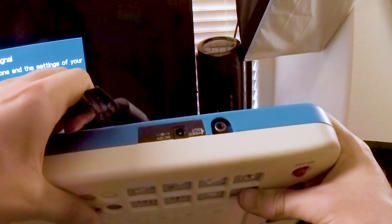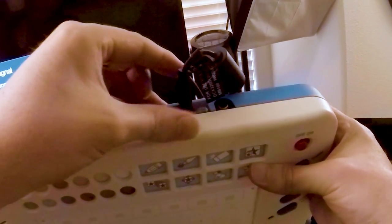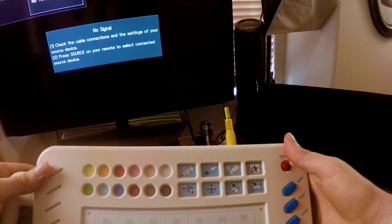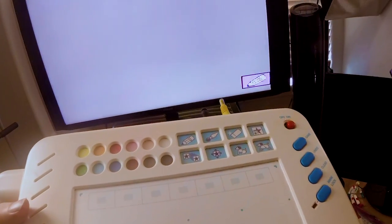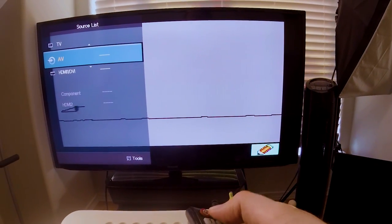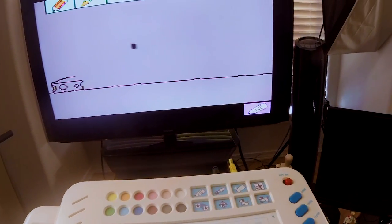So now let's move on to what you've all been waiting for — drawing on the VTech Video Painter. I'm going to plug it into my HDTV, strap on my GoPro, and do a little bit of drawing. Here we go. I'm going to show you how to connect this to a modern-day device such as an HDTV. You need your 12-volt adapter, which we plug in here to the DC 12-volt, and then plug in the video cable into video out — that's all we need for cables. Now I'll turn this on. What's important is that your TV's input or source is set properly, so I'm going to hit Source on my TV remote and make sure it's set to AV rather than HDMI. You can hear all those beeping noises letting you know the tablet's working.